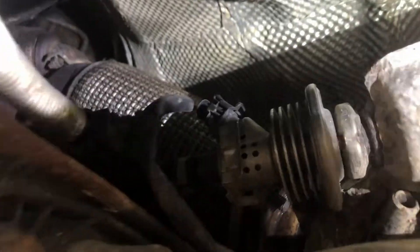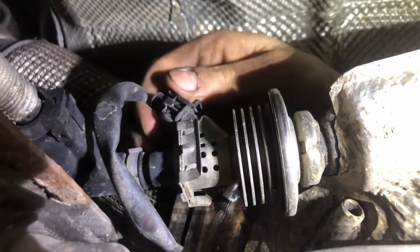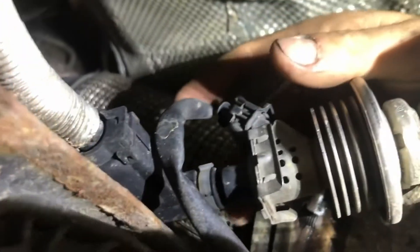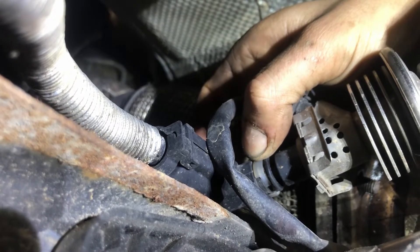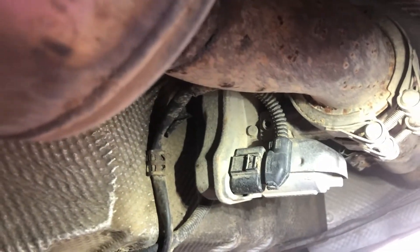For the connectors on this back half: the electronic connector for the DEF injector just has a little tab on top and you should be able to wiggle it off. For the DEF line itself, have a jug underneath in case a little DEF squirts out — it's got a little tab on each side, so just squeeze it together and pop it off. Further back, the exhaust flap uses a normal Volkswagen connector — push down there, same kind of deal, shimmy it off. Road grime gets coated in there so you may have to pry it a little bit.